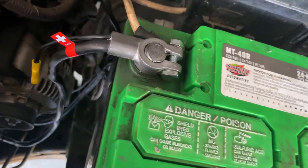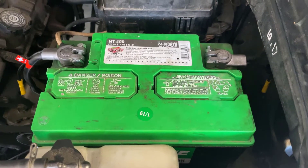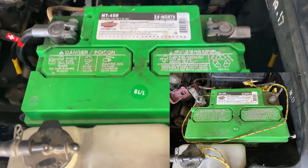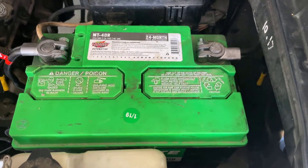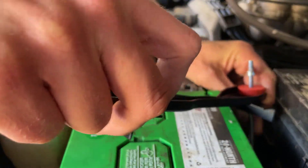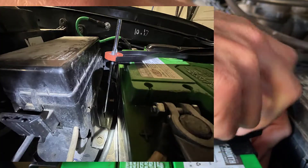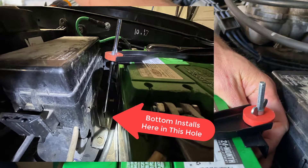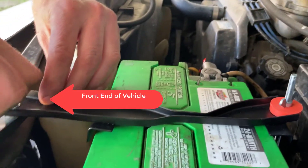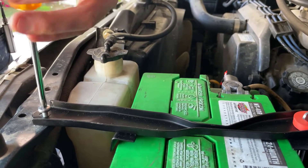Here is the completed product with the brand new cables in place — everything looks awesome and I'm very happy with how safe this is. The battery could fall over into the engine and had twine around it. To make it extra safe we'll put on the final touch: the battery hold-down strap. The J-bolt goes in first — it hooks into the sheet metal in your engine bay at a little knockout, and you tighten it down on that side first. Then on the front end there's usually a threaded connection that threads right in, and both tighten down to hold the battery in place and keep it safe from moving.